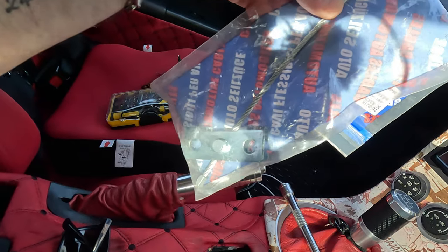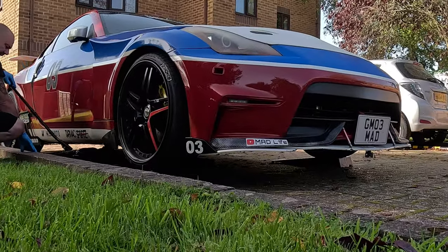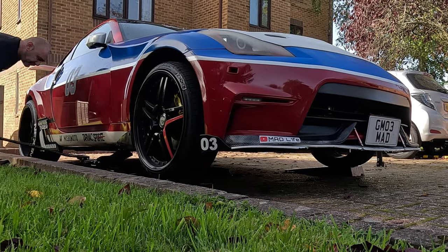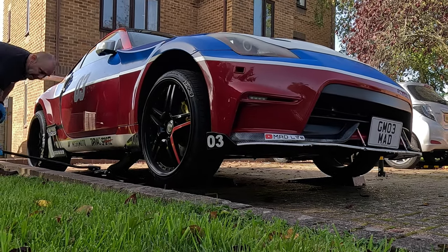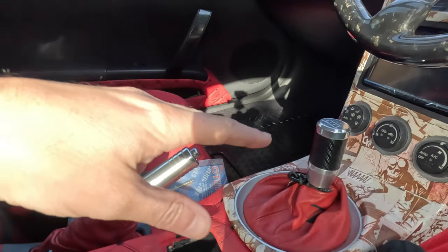What we need to do is go underneath the car and unhook this section. Then we need to jack the car up — we're going to jack up both sides and use actual stands to make sure it's nice and secure. I'm going to use chocks under the wheels, and I've left the car in gear so the rear wheels are locked up and it's not going to roll backwards and forwards when we're jacking it up, because obviously the handbrake is not working as it's not connected anymore.